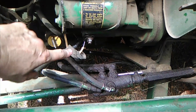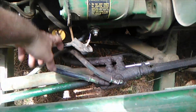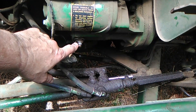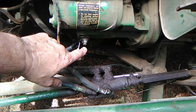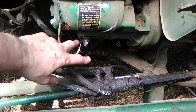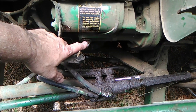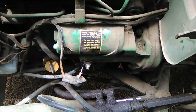I was looking at this and I see the electrical connections. This is the hot wire from the battery; this wire goes to the alternator. I took these off first and they were corroded real, real bad — just rusted. So I went and got some 60 grit sandpaper, cleaned them all up real well, put them back on there, and boom — it started the first time.